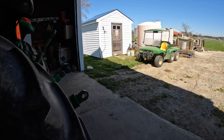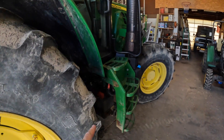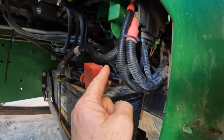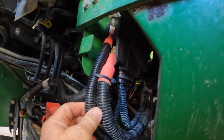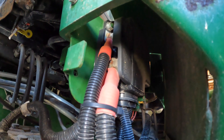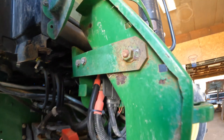The first thing I think I will do: I'll come back over here and clean both terminals up on the battery. Then where it goes up here to this junction box, I think I see a little bit of rust on those studs, so I think I'll pull those off and clean them up a little bit as well, and then we'll go from there.